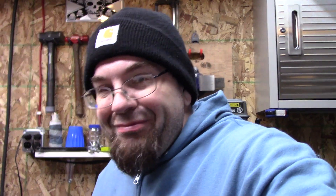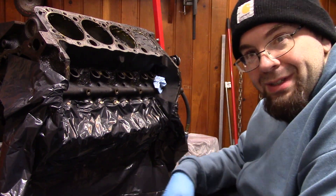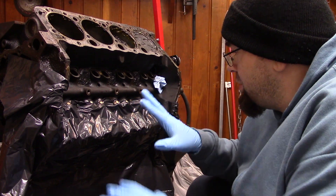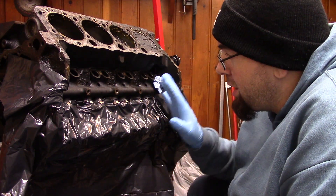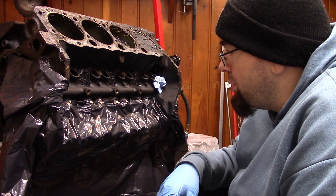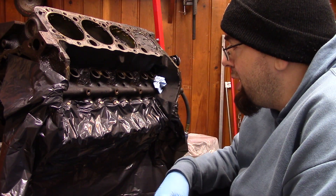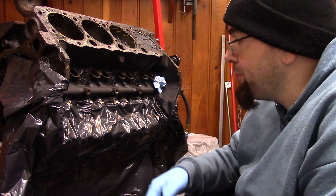I think this is going to work — it's not going to be 100% foolproof, but I'm really interested to see how it goes. This is the kind of thing you'd want to try on this engine rather than a good engine. I ran out to the garage, got my creeper seat, got to get nice and low with a good line of sight. I think we're going to start with one of the middle holes first — easiest access. I'm not going to use any lube because this is cast iron, which has graphite — carbon basically — in it, so the tap doesn't need that. I'm going to give it a little bit of chamfer to start off.